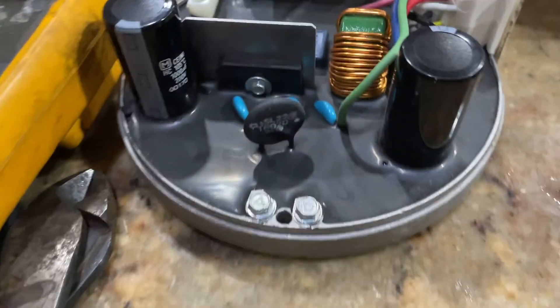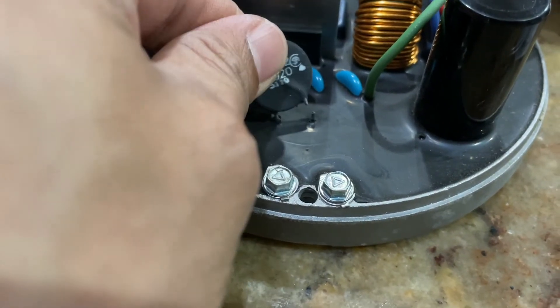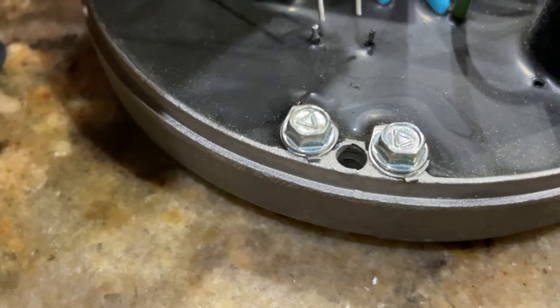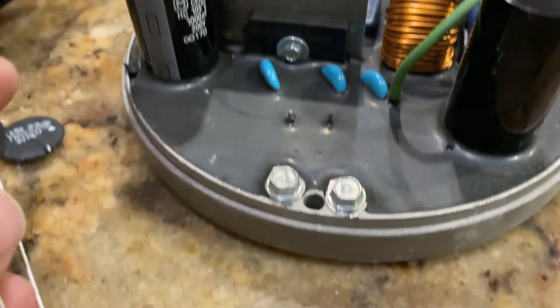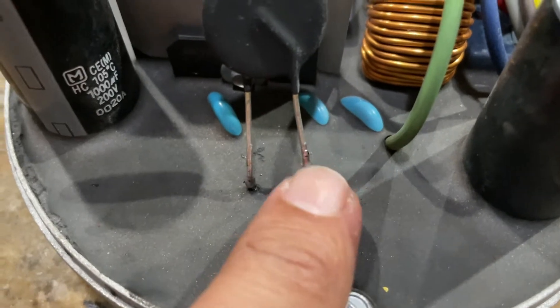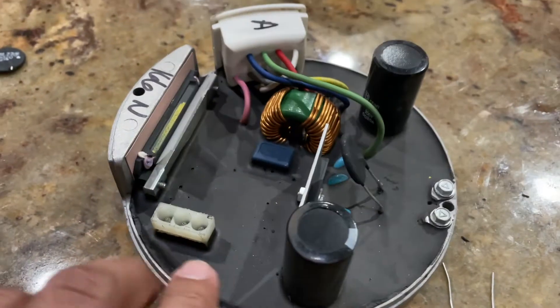Now let's test this one - you're going to have to cut it to do any kind of testing. I cut it off completely. Make sure you leave some lead so you can solder the new one on top, because if you cut it too short you won't be able to. Now I can go ahead and solder it right there. It's just a matter of soldering the thermistor on top - you just need a soldering gun. Make sure you do a good solder so it's not loose and the connections are good.